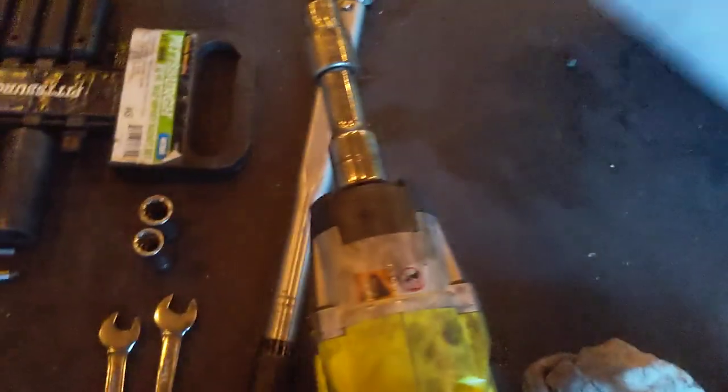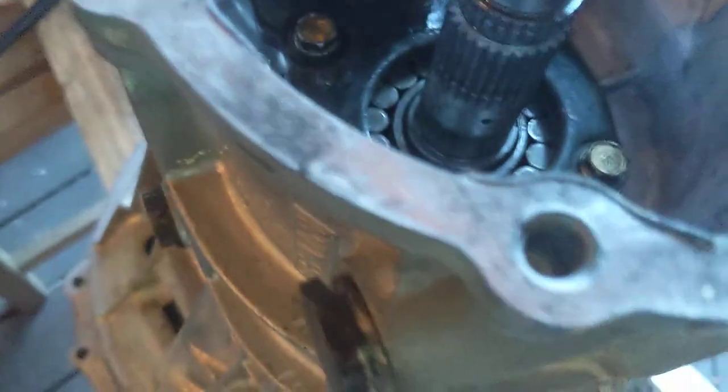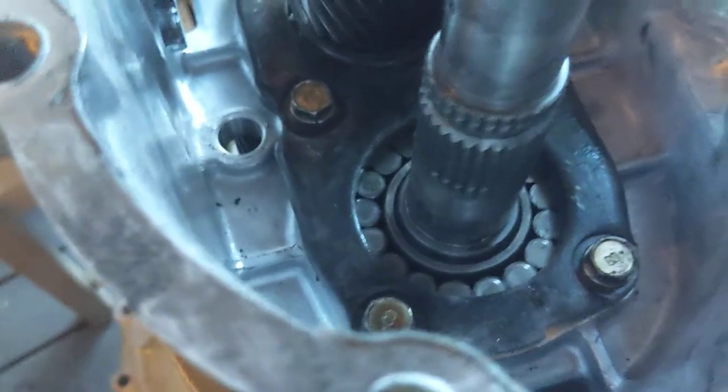Yes. It's one of those that needs the ball bearing. And I just found the ball bearing. That's what reminded me to remind you to get your ball bearing. Here it is. So this gear's hub, so it doesn't spin, has a ball bearing drilled out area there. And the counter shaft has somewhere around it a ball bearing hole. There it comes right around there. See it? So I'm going to put the ball bearing into the ball bearing hole.